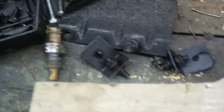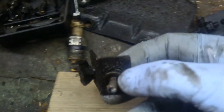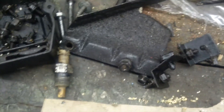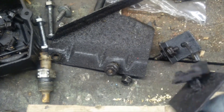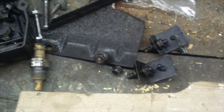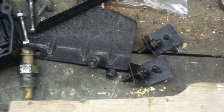I'm not going to use the old bolts because the kit specifies that you use their bolts — they're longer. I'm not putting any of this accessory hardware on until I get the pan on with the supplied studs. Once everything's been dried and set for a day or whatever, when I go to put these accessory clips on, I'll pull those bolts off and put those on. I just want to get the thing on and make sure it's not leaking.